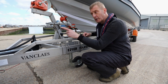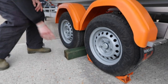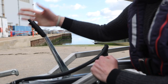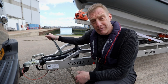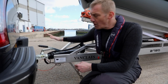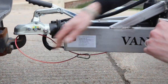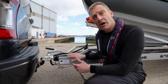Before disconnecting, chock the wheels — I like a big block of wood as well as purpose-made chocks. Nearly all trailers have a handbrake; push the button and pull upward. My concern with them is they're used rarely — a boat can sit on the trailer for six months and the brake seizes in position, so when you release it the wheels won't turn. Key things to remember: the handbrake must be off for towing — that means horizontal. The safety brake cable must be attached to the tow vehicle; if the hitch were to come loose, it would pull the brakes and bring the trailer to a halt.